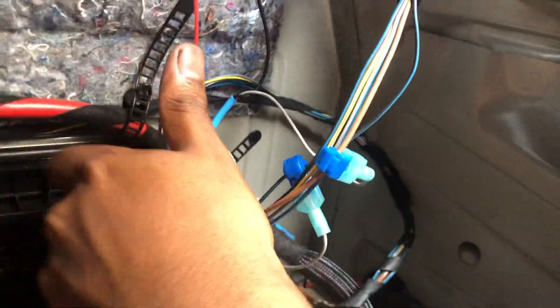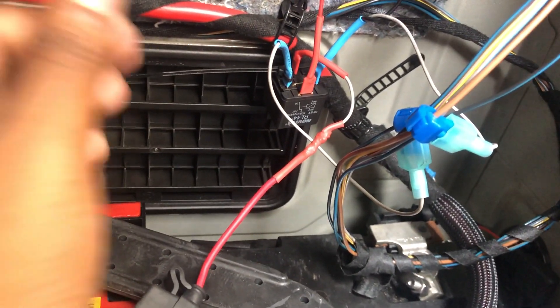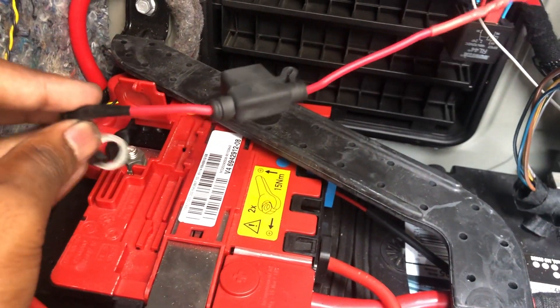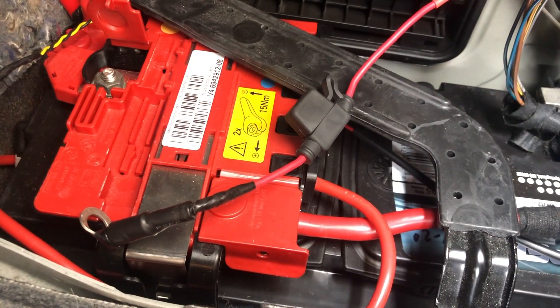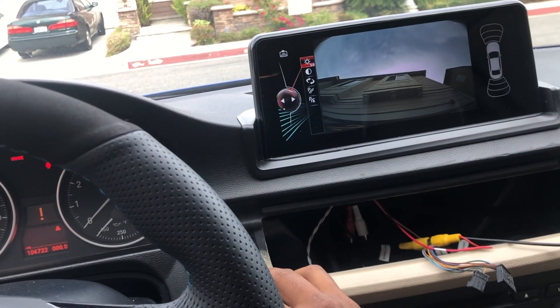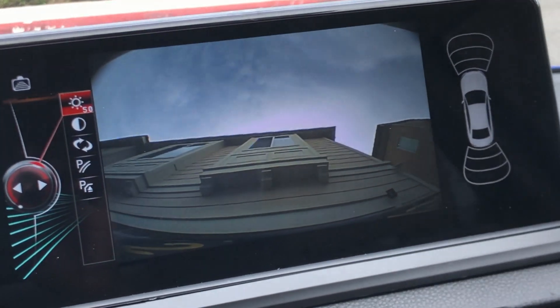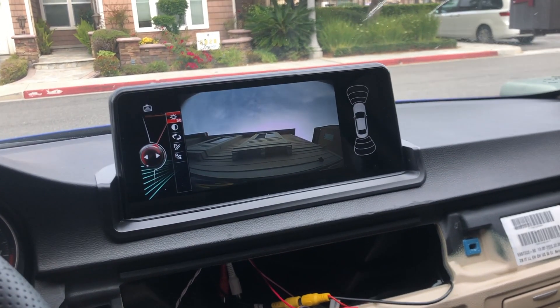Alright, so here's what I've got — it's a bit messy but it all works out fine. Got all the wires hooked up following the diagram, fuse working and all that. I had the ring terminal resting on the battery terminal to make sure it worked and it worked fine — I'll bolt that down properly. The screen was working just fine when the engine was on instead of shutting off like before. There were still some wavy lines as expected before starting up, but after starting the car — nice clean signal, no need for a noise reducer. That line is pretty clean. I don't even really need this camera, but since converting to manual I thought I might as well make it work.